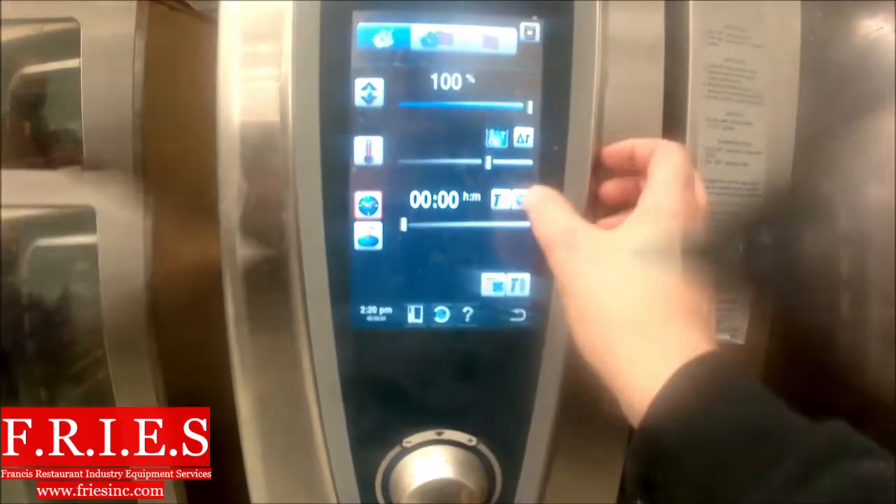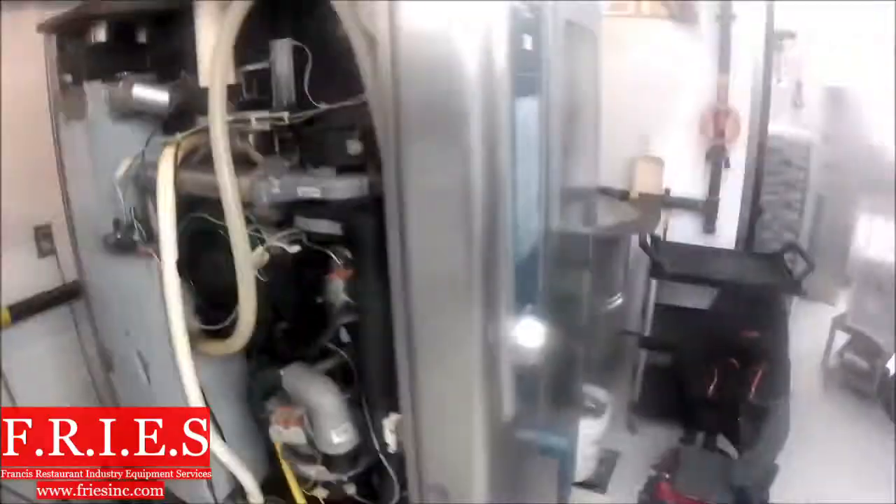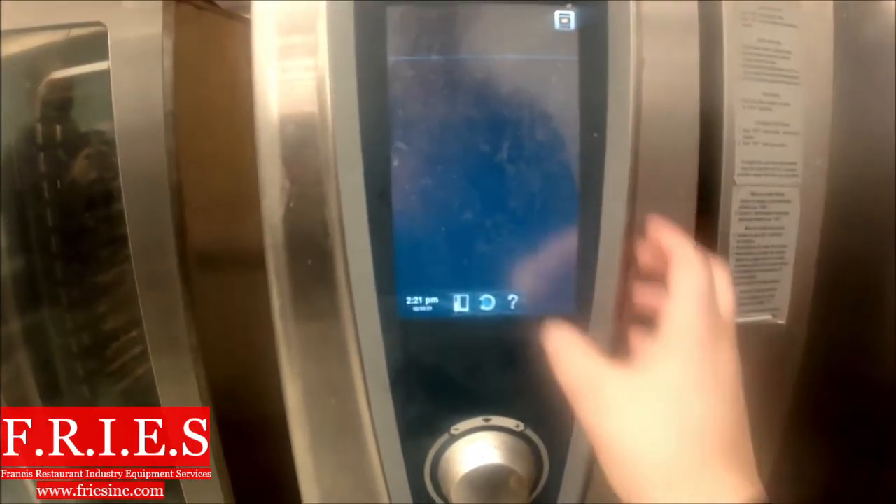The last thing I'm going to do is fire up the oven in steam mode. We're heating in steam mode, then I'll go to dry heat mode — the reason I'm doing this is I could have disconnected a wire, so it's just a good habit to run the unit. This unit has two heat exchangers, so you want to make sure both are heating, and in this case they both are. We had an oven that hadn't been cleaned in over two weeks waiting on approval for that pump. If I could go back I would have probably ordered those hoses too — they're not in the best condition, but they are holding.